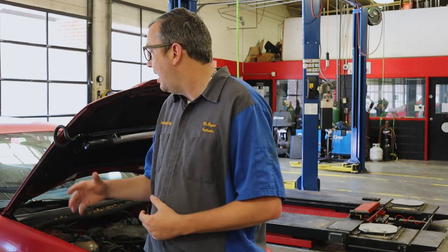I'm Mr. B and today we're talking alternators. We have our $400 Jetta here behind me and I'm going to show y'all how to remove and replace the alternator on this car. Most of your Mark IVs are going to work the same way. Some of the engines are a little bit more difficult. This is actually one of the easier engines to do alternators on, and we're going to go over how to remove the belt, the tensioner, and the alternator.